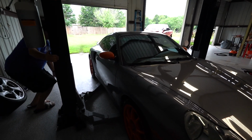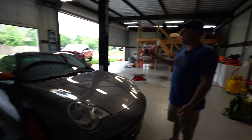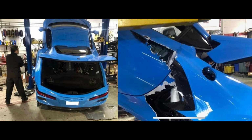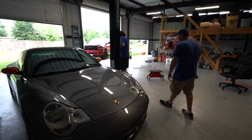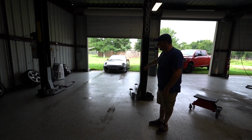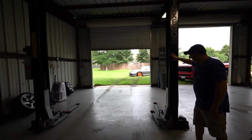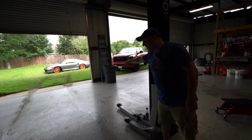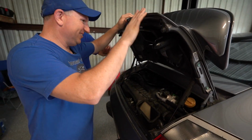Yeah. Well, dude, haven't you seen those pictures of all the Corvette idiots that got their new C8s and then fell off the lift? All right, I'll move it. Okay, I mean, it's safer. Look how long the arm is, right? So you want the weight as close to this as possible. If you have the rear weight way out there, because the active aero, that wing's heavy.